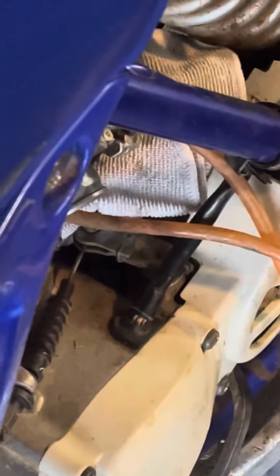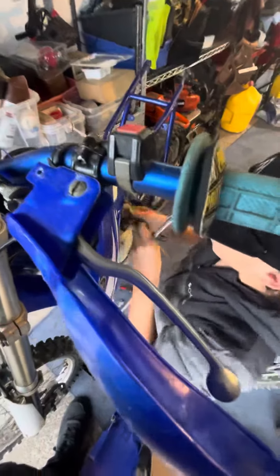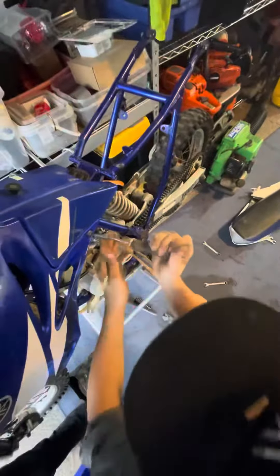So where does the adjustment and play come in? If you don't have any play, meaning if you go to pull this lever in right now and it has very little play, you're probably almost too close on the pressure. We're going to turn this out and that takes up all the play in the lever. Sometimes you'll go up to somebody's motorcycle and feel that it's tight — it has no play in it. What that does is it means there's no play down here. So as soon as you touch the lever, it's acting like it's pulling the clutch in. So there's no free play — it's already on the plate. So that clutch will let out really, really late and it'll be at the end of the bars, and you might give it full throttle and it could spin because it's actually holding the clutch in a little bit.